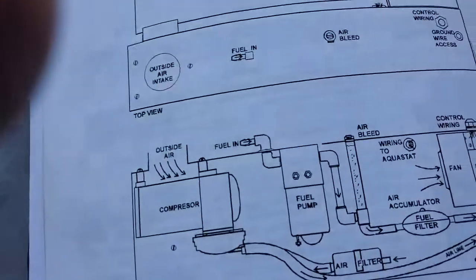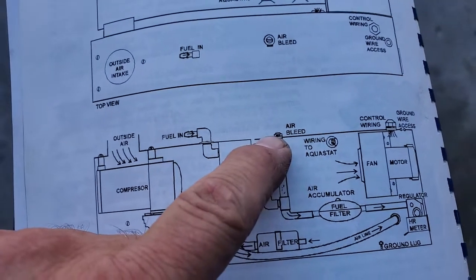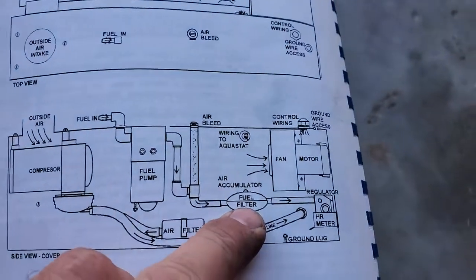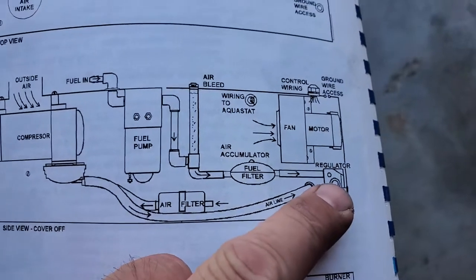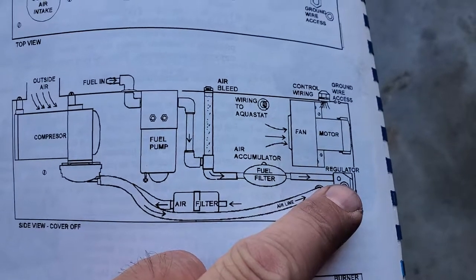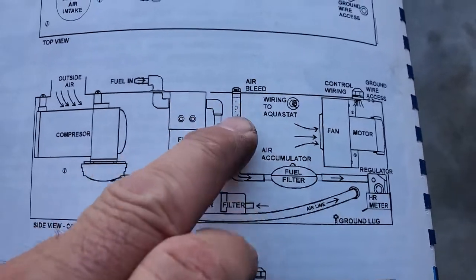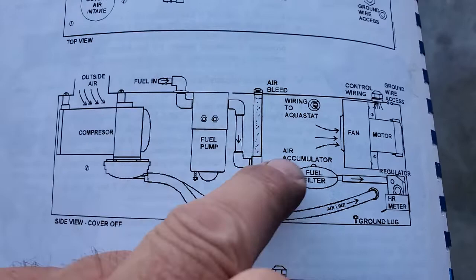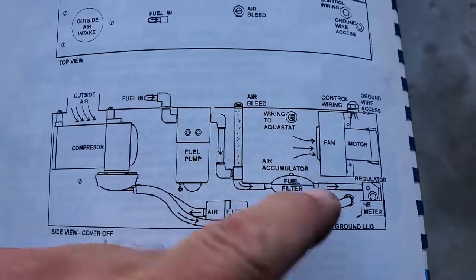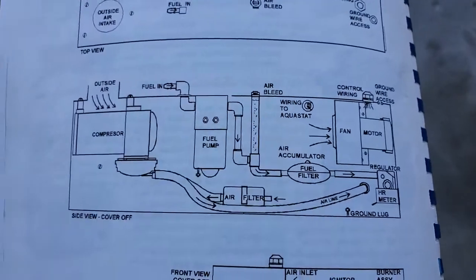We're going to deadhead the fuel pump. The fuel comes in, gets drawn in by the fuel pump, goes to the air bleed. I'll hook my pressure gauge into the air bleed. Then there's a fuel filter, and then that goes to the regulator. The regulator is like a miniature carburetor — it's zero PSI, it needs the air flowing, which we did in the video prior to this, that's the air check for PSI and amperage. I'm going to bleed it out this way, let the pump run free. We're going to see how many amps we draw — just a good check. We'll tie the two together so I can show you the jet spray, but in this video we're just going to do the amp draw and the pressure check on the fuel pump.